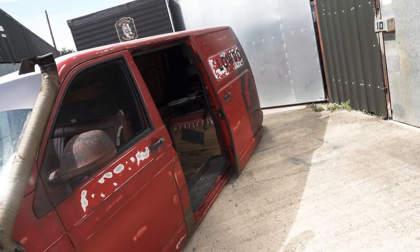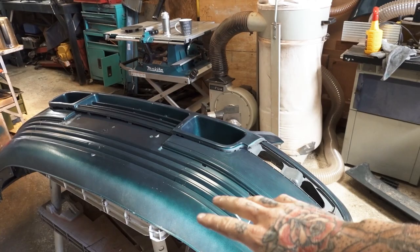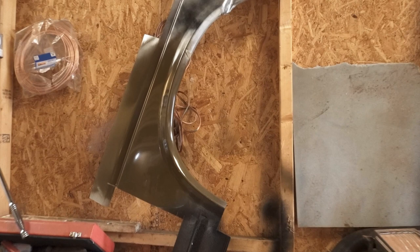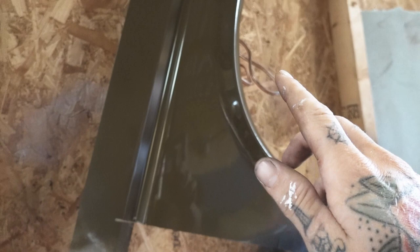I am loving this thing already - it drives so good and it gets so much attention. It's going to be bloody good for my joinery company. I've got the new bumper there and I actually mocked up a panel and painted it the other day. The color on the camera is the chocolate brown I'm going to be going - it's Montana Gold graffiti paint with a UV resistant varnish over the top, 1500 gritted back and polished. I don't think that is too bad to be honest. It's an acrylic based graffiti paint and the UV resistant varnish set really hard and smooth.